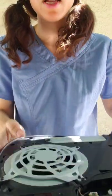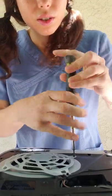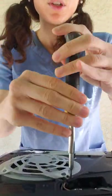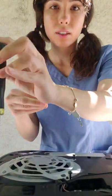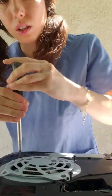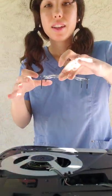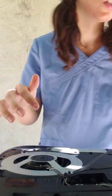You will need your T9 screwdriver to remove the plastic vent for the fan. When removing the screws, I like to keep them in the place from which I removed them, because the screws are different sizes. If this is your first, second, or even fifth time doing this, it's a little hard to remember exactly where the screws go. Keeping them in place makes it easier to reassemble.